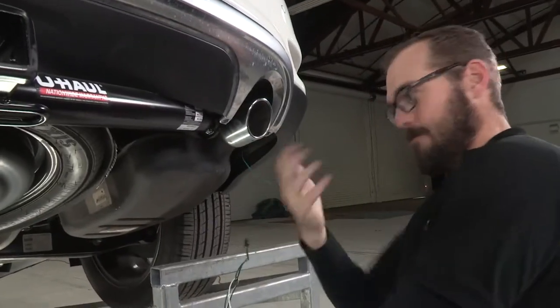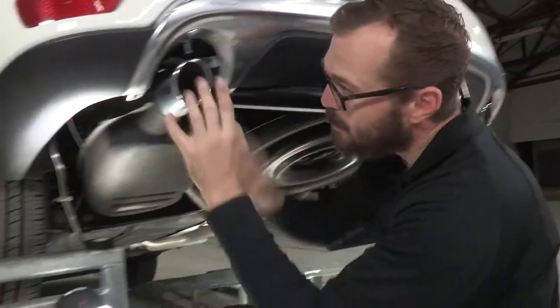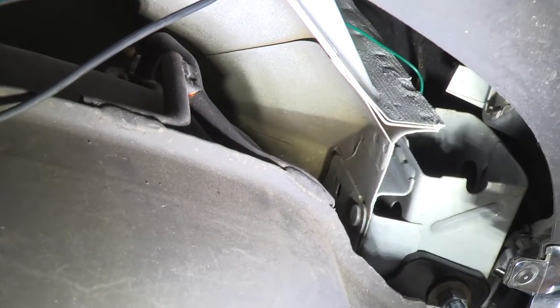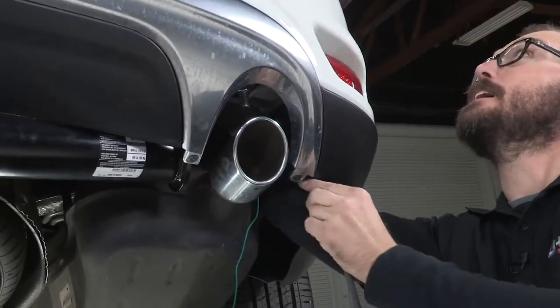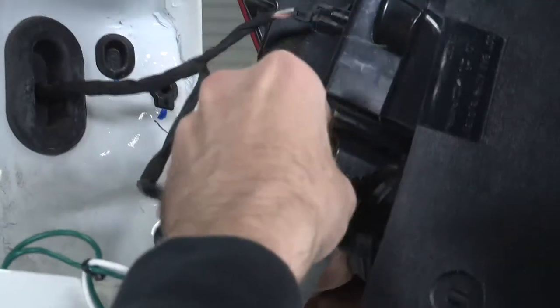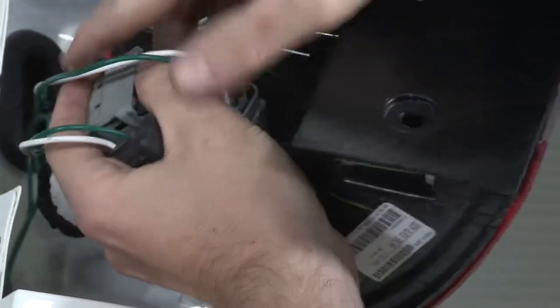Now I've got my wires pulled through that crossmember. Before I proceed to run the passenger side harness up to the taillight, I want to go back to the driver's side and make sure that this green wire isn't contacting anything sharp, that it's got a little bit of slack in it, and that it won't be damaged in the years to come. Back on the passenger side, I'll use the fish wire to make sure that I end up having this adapter harness exactly where I want it — above the fascia right to my taillight housing. Now I can disconnect the tape, remove our turn signal connection, and use our quick connect harness to make our connections to the taillight and our factory wiring.